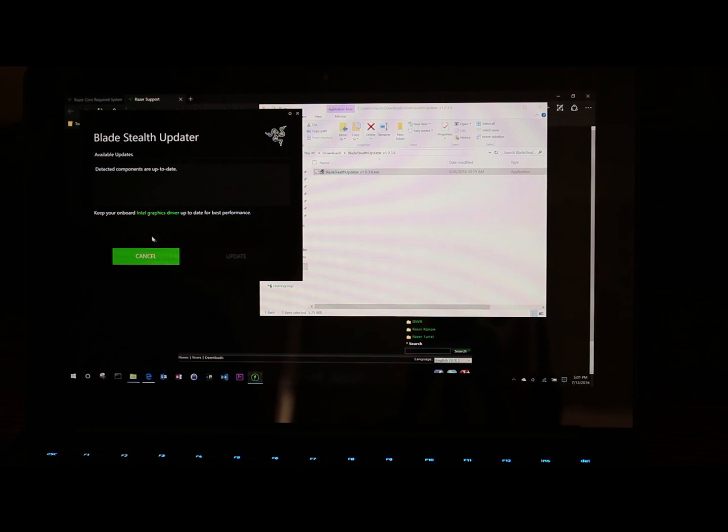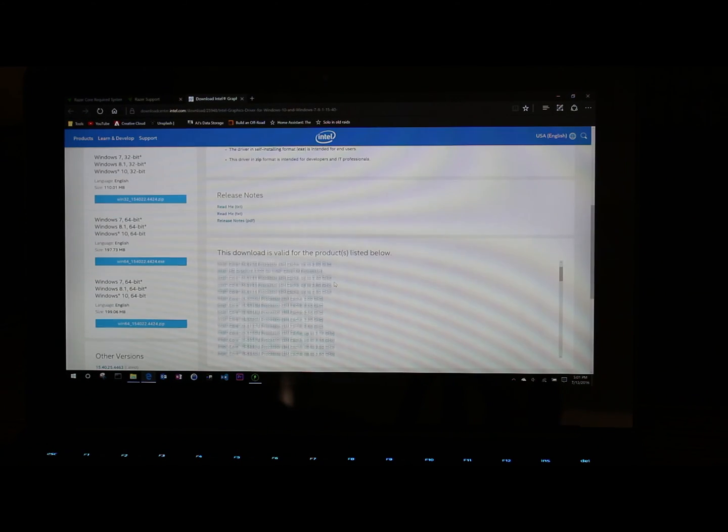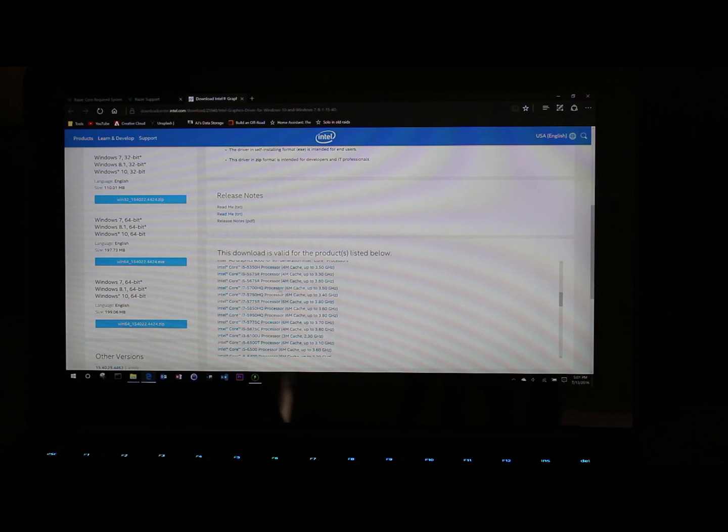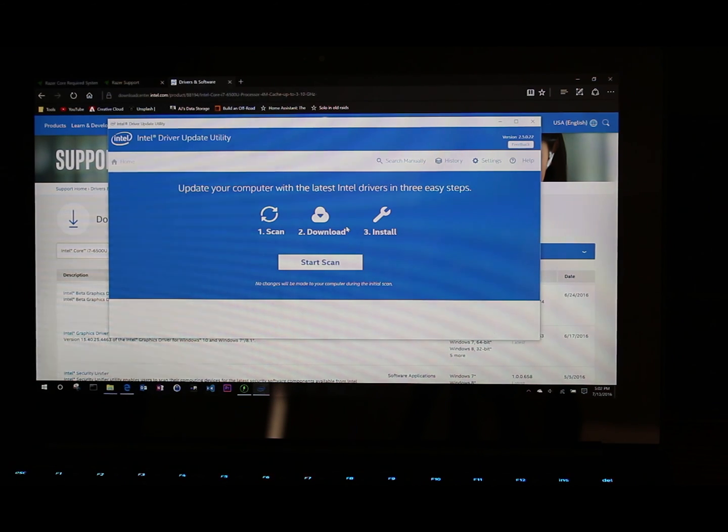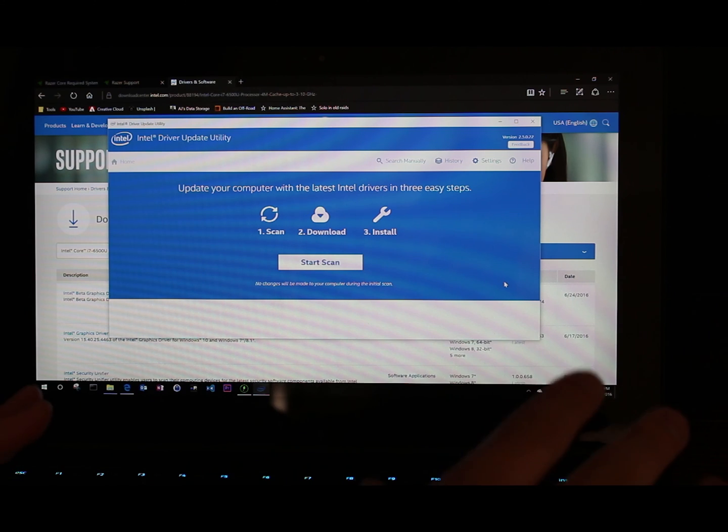In the link below there is a great article that talks about their experience and trials with getting Dell's XPS 15 and the Razer Core to work together. In summary, you have to make sure all of the drivers are up to date on both the laptop, paying specific attention to Thunderbolt 3 drivers and the drivers for the GPU you intend to put in the Core. It is up to the manufacturer to make sure this works on their system, and it is very unlikely that most laptops out at this point will have that updated. They need to make sure that Intel's newest Thunderbolt 3 drivers are compatible on their system and won't interfere with any of the other firmware on that specific laptop.